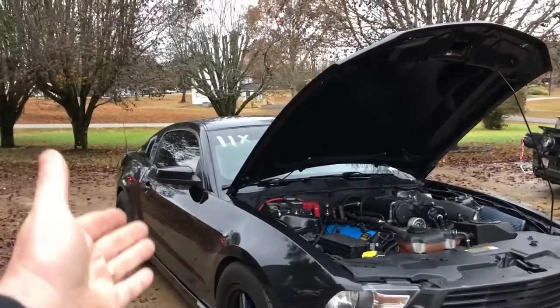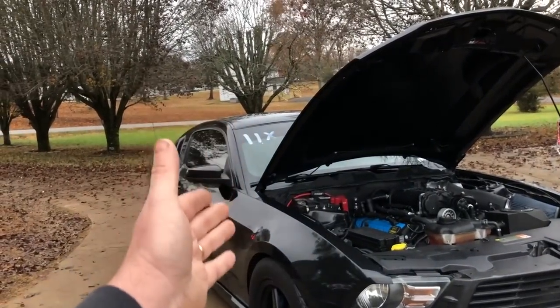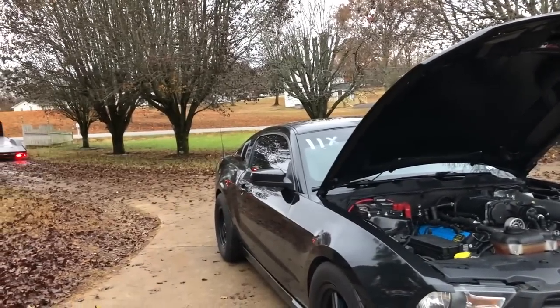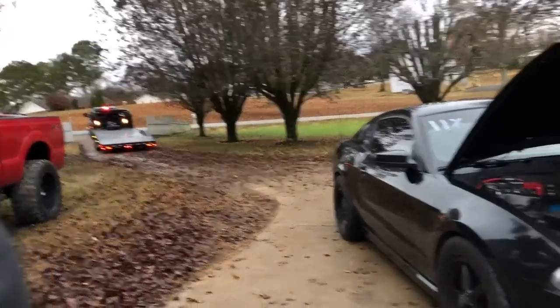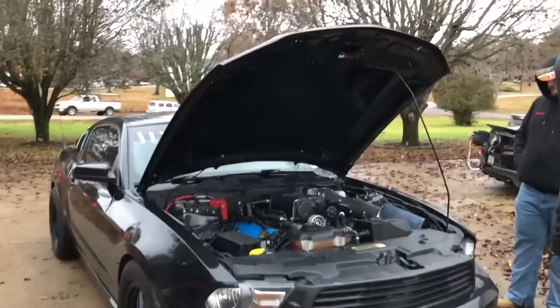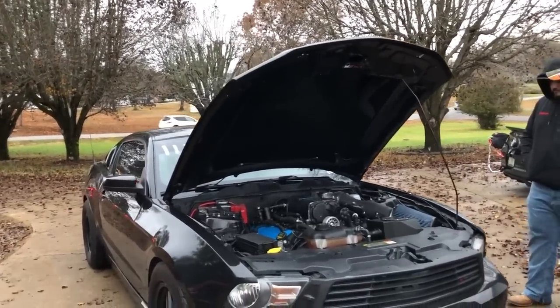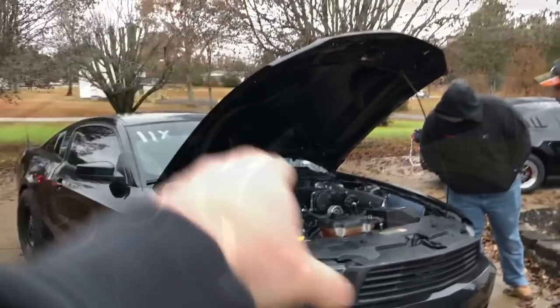The transmission's built. He said the rear end's built too? Yep. So we got a built rear end. I got all the paperwork on the built rear end. Turbo 400, stage 3, JPC transmission, 35 spline axles. So it is begging for the Gen 3R. It's already set up for a blower, so take that blower off, Gen 3R on, and you are off to the races. And it's already run 9.3 on the Roush.